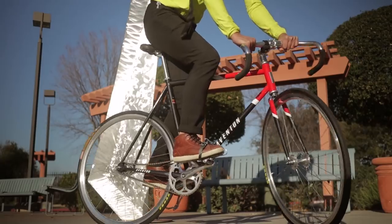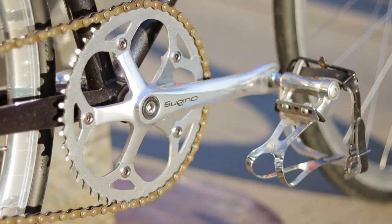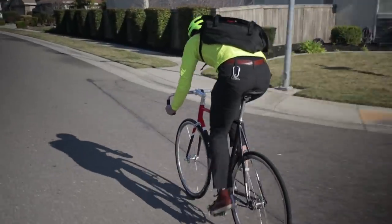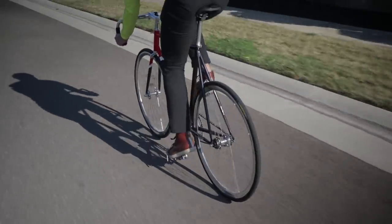The drivetrain is much better than a lot of the Andreas' competition with the Sugino RD2 cranks. The RD2s have been the nicest 130 BCD crankset that I've tried, and they're even stiffer than the in-house 144 BCD cranks that State and Aventon have to offer. The chainring combined with Aventon's own CNC cog makes for a smooth-running drivetrain, which is a little curious since the chainline may not be perfectly straight.